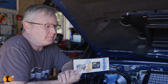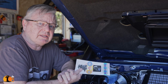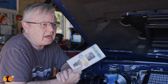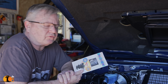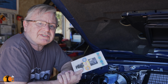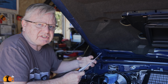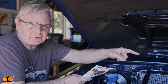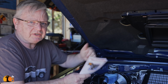But that engine, like this one, has a pretty good filtration system put in by the manufacturer. But I'm going to make it even better, and every vehicle that I have built, and I know Paul Marsh is exactly the same, every diesel vehicle that he builds for his customers, one of the non-negotiables is you put in a secondary fuel system to catch any of the bad stuff, especially water, first, before it goes to the Toyota original equipment filter, which then feeds the engine.